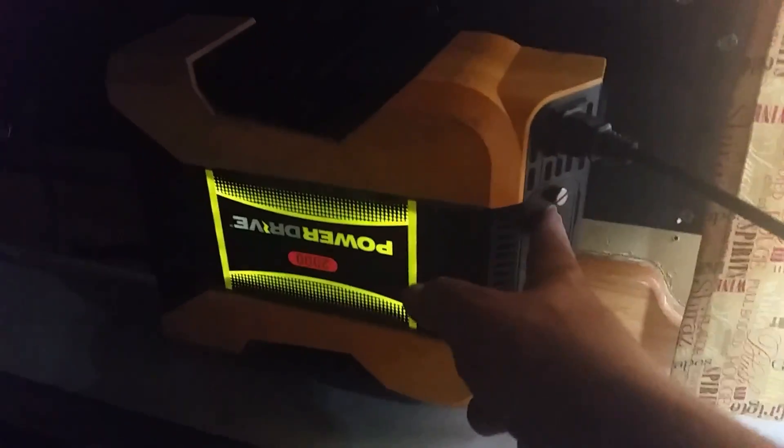The inverter is showing 13 volts right now. The cable run goes from the kitchen all the way back through the bathroom, along the floor, out through the back, and into the battery box — it's a bit long for the gauge of wire I'm running, but it does run coffee pots, a griddle, and all that without any real issue. The battery voltage has to drop to around 11.8 before it reads 11.2 on the inverter and starts beeping. There's also a charge splitter — a pegboard bank — where my connections plug in, and I could add more later on.